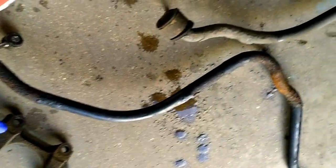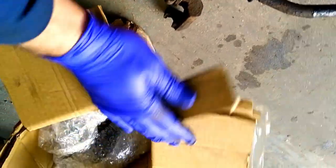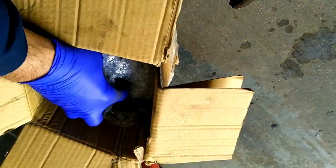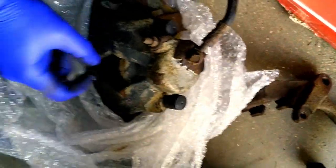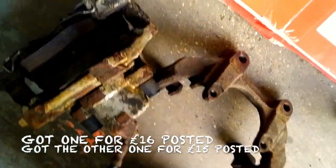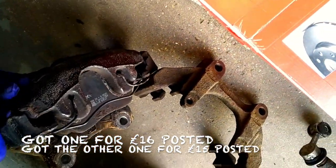To keep costs down, I actually buy an Audi TT caliper and carrier off eBay. These go for anywhere between £15 to £18 delivered. I don't really care about the condition because all I want is the carrier - some people tend to sell the carriers by themselves and a pair of 312 carriers can go for around £50. So I end up buying two calipers I don't need because they're not sided to the carriers.